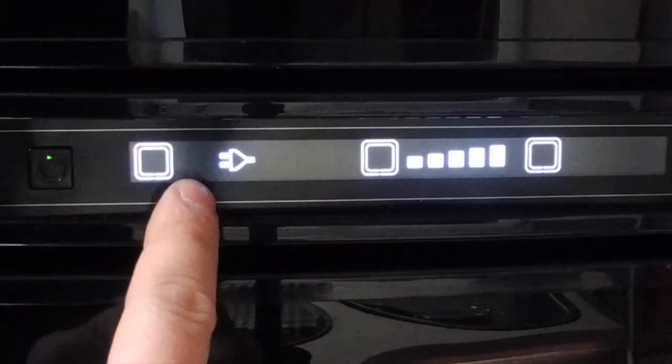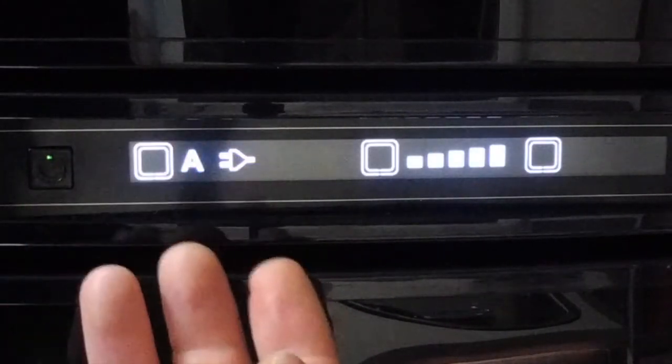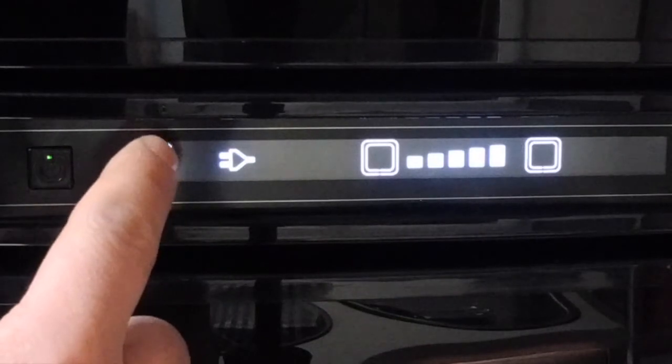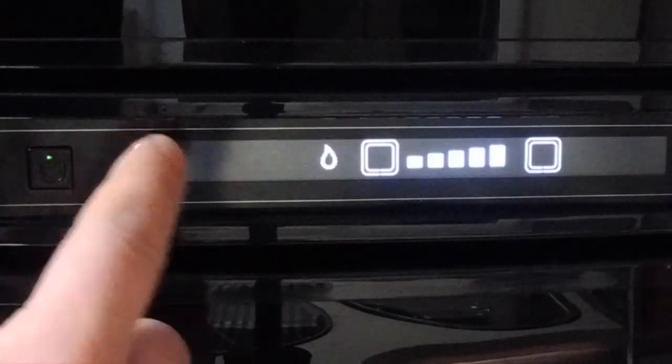If your refrigerator has an A, like this, it will select the refrigerator source automatically. It will then take what is most available. If it does not have an A, you have to manually select the source and switch source when you stop and when you drive.